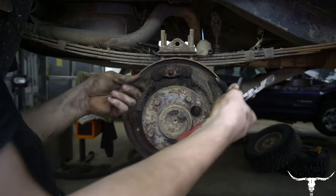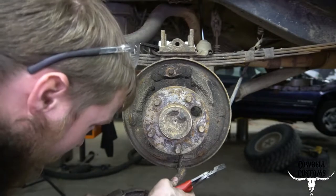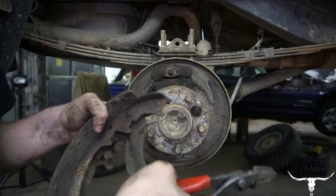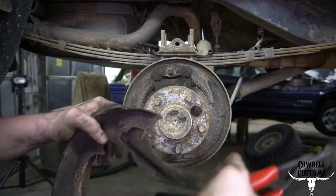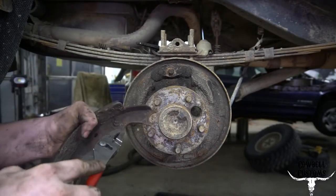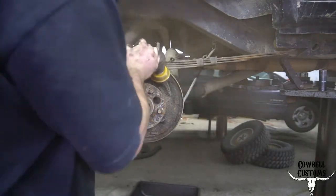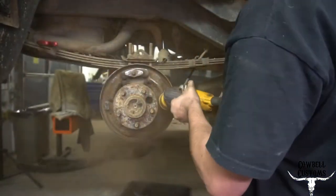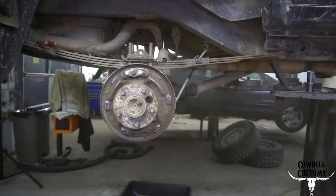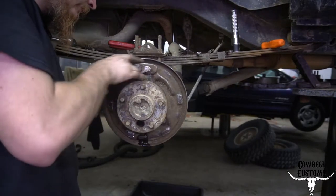Let's go — doing wheel cylinders. I need these little nubs; they come right out. I'm going to clean everything up. I just got to get moved over to the new set of shoes yet too, so that basically comes off. If you have a good hardware kit it should come with them. In my instance I have to reuse it because I have a bad hardware kit that is wrong for everything I'm doing. Got to clean all these little pads up or else stuff will stick. After much fighting — wheel cylinders out, in the trash.